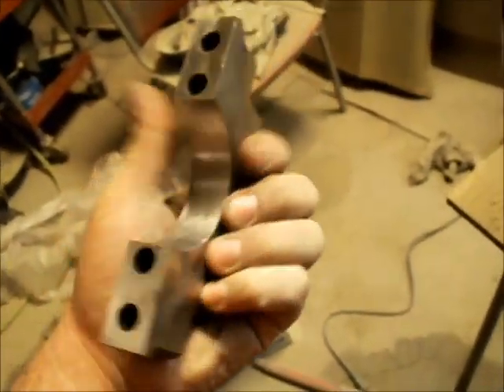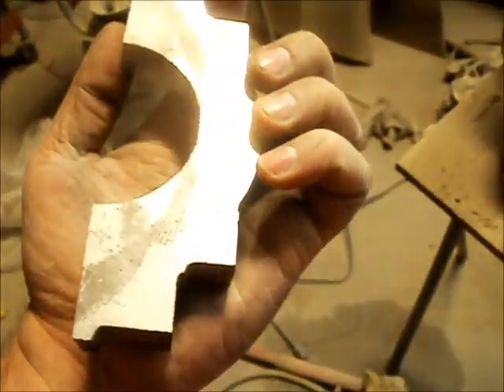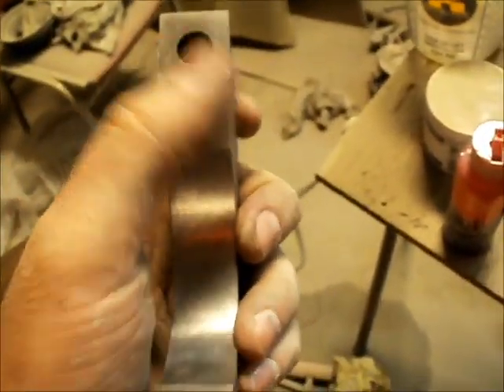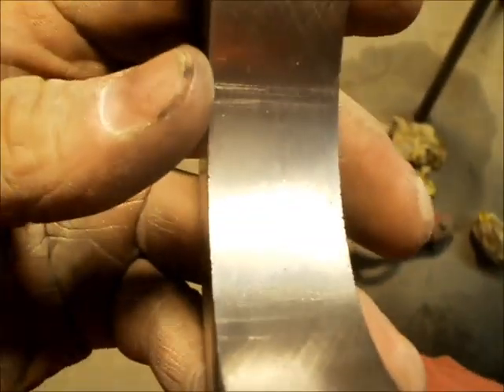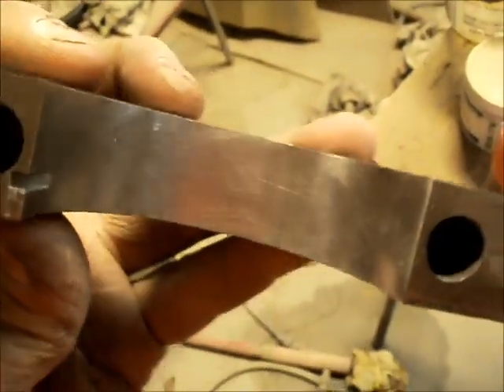As you can see, these caps are stamped on the face. I want to show you a motor that's been line honed. You can see the side of this cap has been machined — looks clean and new. Now if you look at this side, you can see where it's been machined. You have to true up the cap side before they cut them, so when that bolts together the hole is actually smaller than it's supposed to be. Then when they line hone it, it's back to true round. And as you can see, the cross hatches from being line honed — if you don't see those cross hatches, it hasn't been line honed.